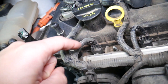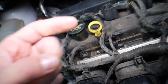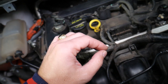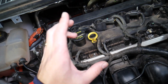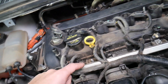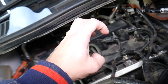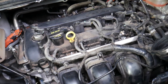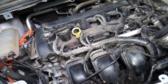Another cause is a leaking fuel injector — one that's spraying way more fuel than needed will cause a rich fuel mixture. Also, a bad fuel pressure regulator can easily cause that, because high pressure in the fuel rail means more fuel is being sprayed, resulting in a rich mixture. If you have the direct fuel injection engine, the fuel rail pressure sensor could be malfunctioning, or the direct fuel injection pump's volume sensor may be sending too much pressure to the fuel injectors as well.